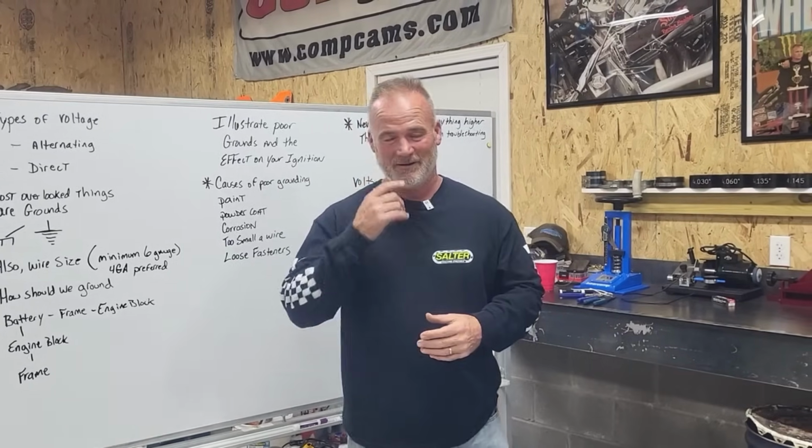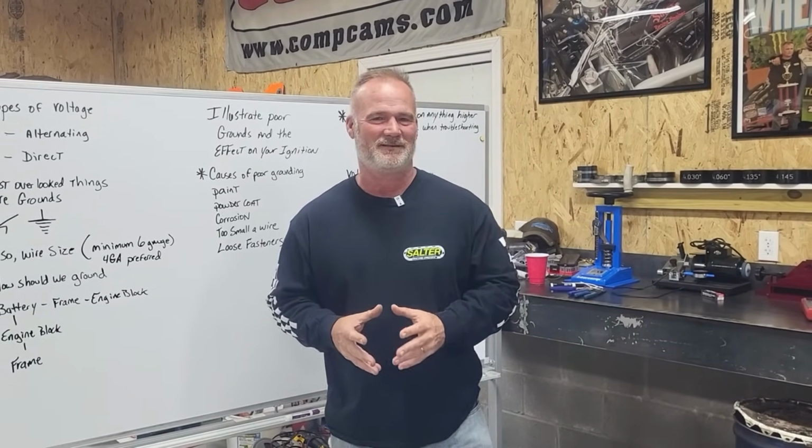All right, guys, so I'm smiling because at the 19-minute and 28-second mark, I got zapped. I mean, it came through the table, through the distributors, through the drill handle, and popped me. So that's why I was emphasizing these boxes with high amps are no joke. The reason it did that is because even though I had zero continuity, and you'll see in the rest of the video, I did not grind all the mill scale off of that steel.